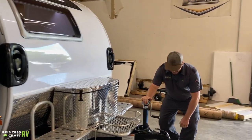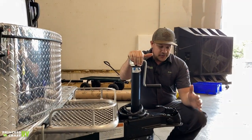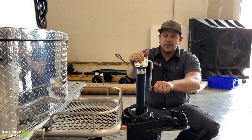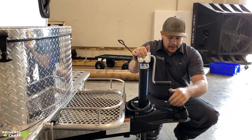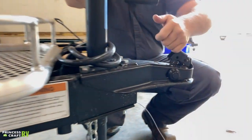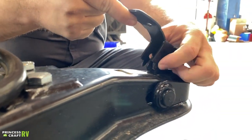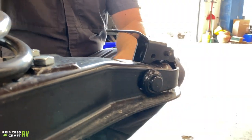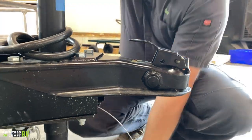This trailer is going to ride on a two-inch ball. Once you get it lowered down on the ball using your standard manual crank jack, all you've got to do is pick up on the back here and slide the coupler forward. Get it to latch down — make sure these ears right here fall down into that cavity and you'll be latched on and ready to go.